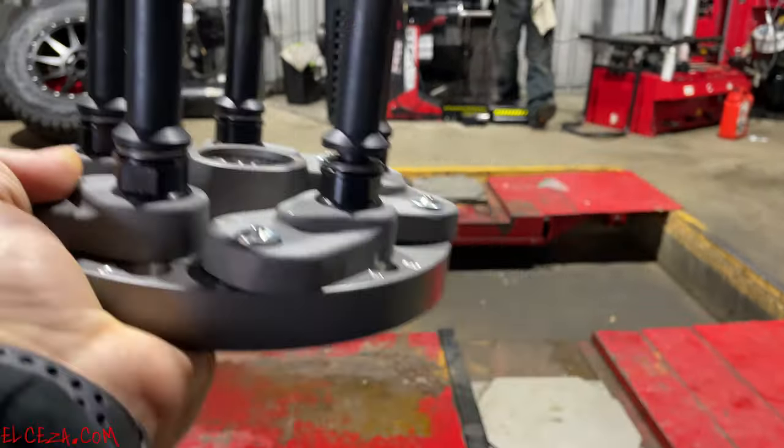Then, if it was red, you went back and recentered it. If it was green, our original Road Force, you dropped the hood again and spun it, and then it gave you your weights. So we dropped the hood three times to do a centering check. Guys, especially knowing that odds are good we're going to get to break this thing down and take it back over here, Hunter said, hey, let's go ahead and do the math.